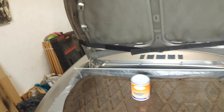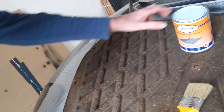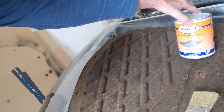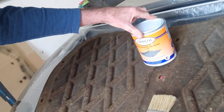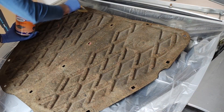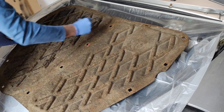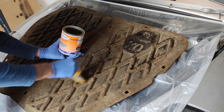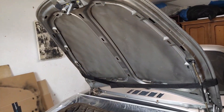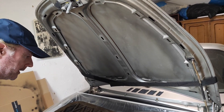What I'm going to use is the glue that I've got left over from when I did the headlining material, which is actually heat resistant — perfect for being under the bonnet. Hopefully once it dries and it's in place it shouldn't sag down, plus the little clips as well, so it should all stay in place nicely. If you're wondering what that black strap is, that's to keep it in place when I lift it up and put it on. Let's give it a go now.